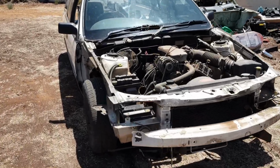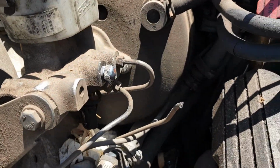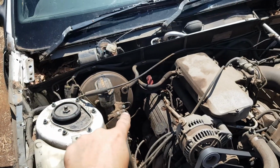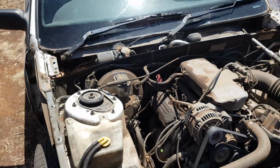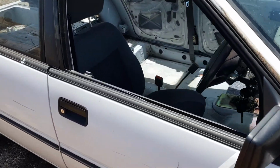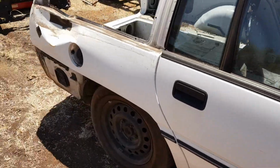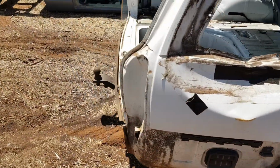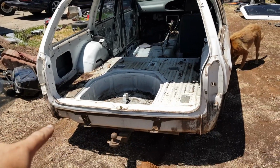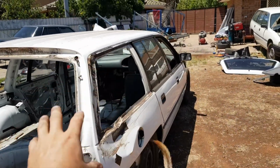Alright, so I had to play with the VS this morning. Just quickly took the rear brake line off and welded the nut shut and put it back together, so that it still has a little bit of brake line in there so that it seals properly, and it's obviously not going to come out the back of the weld. I've just thrown a seat in there, it's not bolted in, so I have to bolt that in and bolt the other one in. And then we've got the rear bar off, all the tailgate and everything. And I ended up taking the back muffler off because it was pretty much exploded anyway. So that's gone, and it all runs and drives.